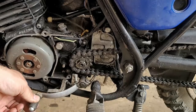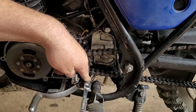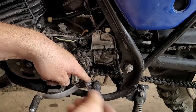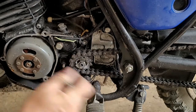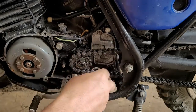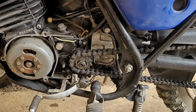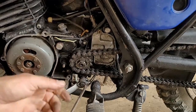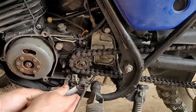Now we're going to remove the shifter — it's even loose. We're going to take this off. I want to show you guys how to fix a loose shifter — you're going to love this one. We're not doing that at the moment, we're going to get the cover on and just button up the side. Here's a flathead screwdriver — I'm using my mallet. When doing this screw job, I'm tapping it on the back side with a mallet, expanding it so it can get over the burr, then working it back and forth, and out she comes.